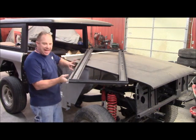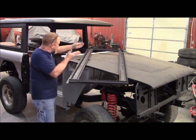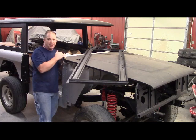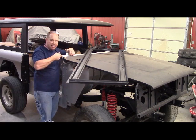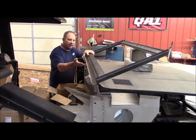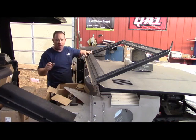Your front window here — I had it blasted and pickled and it's primed now in epoxy primer. The hinge has some stress in it where the bolts were, where it's slid up and down. I'm going to get it out on my anvil and straighten all that out. Then I'm going to set it in here where the hinge is just past the end of this lift right here. That way when the windshield opens, it won't break the paint off. A lot of them have been set too deep, and every time you open your windshield it tears the paint off and the end of that hinge touches and gets a squeak. I'll also tell you one thing you run into with aftermarket stuff: when it's not stamped or pressed properly, the center wants to pull and you get a little arch in it that you have to finish working out by hand.